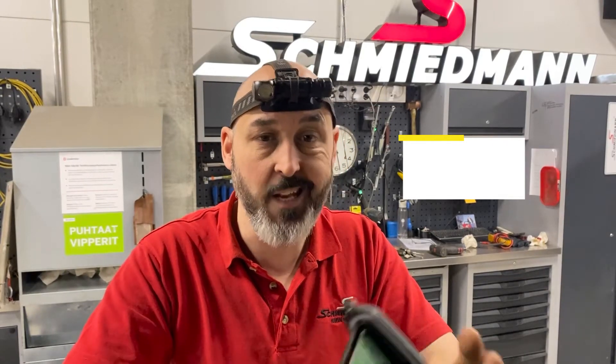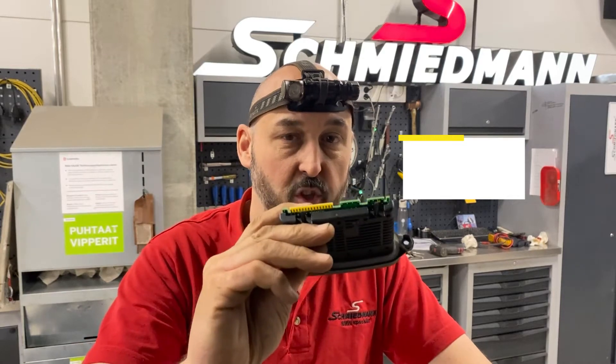It has a fault for the LIN bus on the left and right headlamps; the LIN goes to the footwell module. Also present is KCAN 3, but we don't have a fault for that. I'm guessing the reason we have a LIN fault on both headlamps is either the other one is still faulty but hasn't broken yet, or this water has shorted out the LIN, which involves different pins of the footwell module — it probably does interconnect somehow.